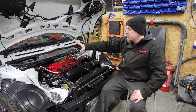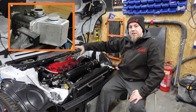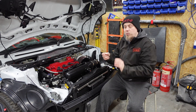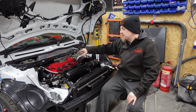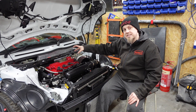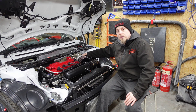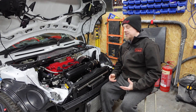What I've decided to do is use a combined coolant and power steering tank that I've made up. Everything sits over there and you change your oil lines, as you'll have seen in one of my previous videos. The coolant tank is essentially welded and the bracket holding it is the original bracket with one fixing tab lopped off and welded in a different location, with some rivnuts added to the wiper support mechanism. It sits in a nice simple location, bleeds well, and is the highest area in the engine bay.